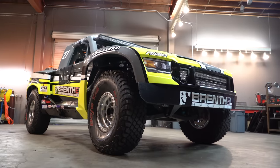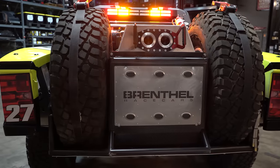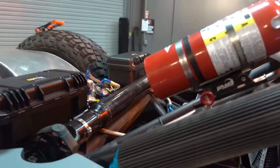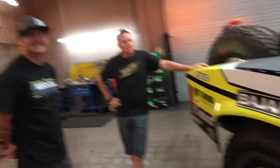The biggest things we've done with corner weights — from our first generation, we started with a rear fuel cell and rear tires, which worked really well in the bumps. We wanted to get a little more steering with our Gen 2, so we moved the fuel cell to a mid position. That truck turned really well. With our Gen 3, we found we'd gone from one extreme to another on the first two, so this is a combination of both, placing it exactly where we wanted based off tens of thousands of miles of racing.